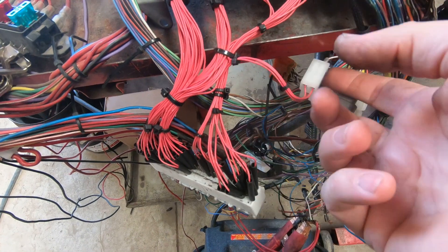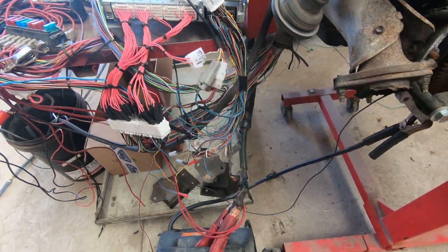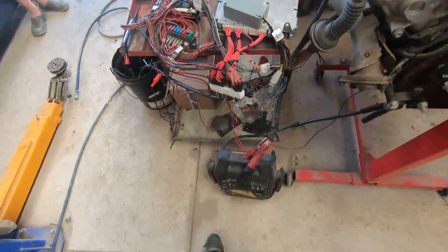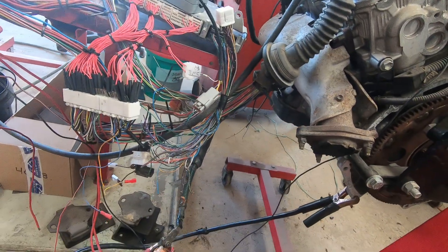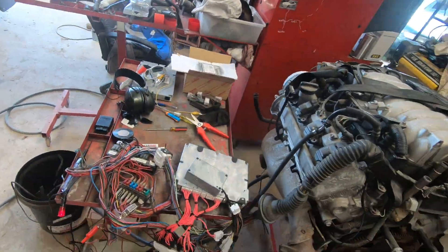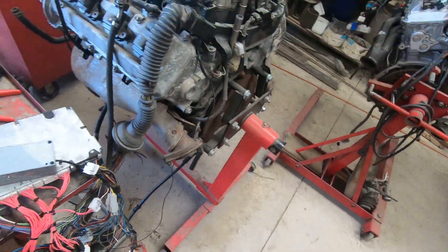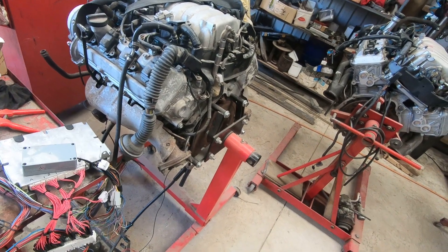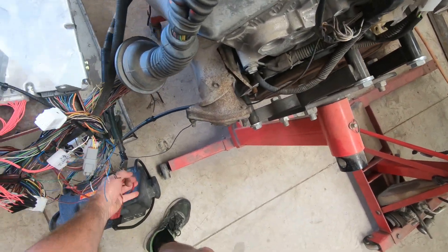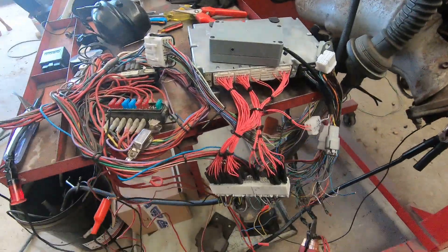I've run the power and earth into my immobiliser, and I've left the immobiliser light wire — which is a white-orange wire — going in, and the customer can take care of the rest of it. This one is actually just going up to Auckland, a jet boat tour operation, but it's going in their road vehicle, not their jet boat. They do have a jet boat with an early UZ. So we're going to power that up and that light's going to go out — which it does. It's perfect. Then I'll put my earmuffs on and we'll start it up again. Yet another one running.